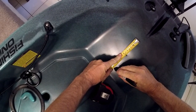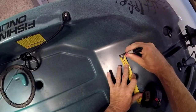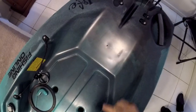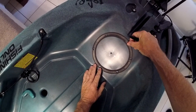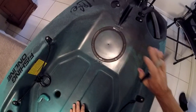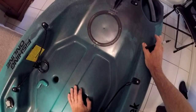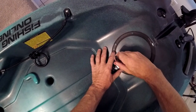I'll explain why I'm doing that in a second. I've got 4 dots here and I'm going to use those as alignment points for the template, just to give me an idea of where I need to be. Now that I have the gasket in place, I put two pieces of packing tape here just to hold it in place, and now we're going to trace the inner hole. Please don't be the person that traces the outer hole — your hole is going to be about an inch too big. We're going to trace that inner hole because that's the portion we're going to cut out.